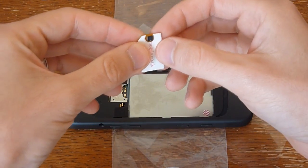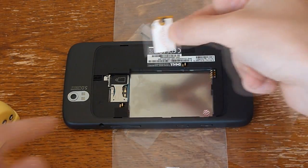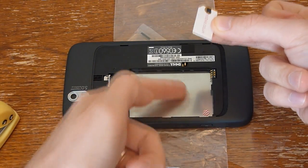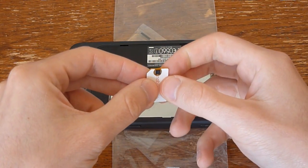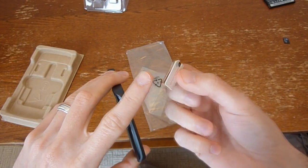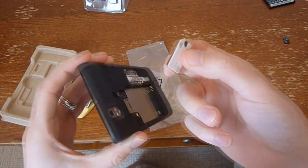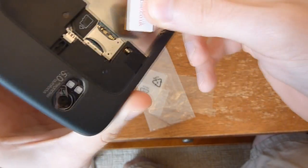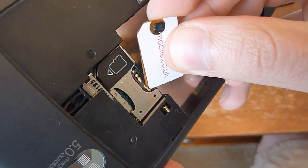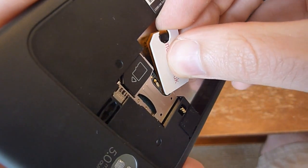The Dell Streak is kind of hard — you can't easily pinch the two cards together while sliding into the SIM slot, because there's no space between where the SIM goes and the casing to fit your finger in there. What I do is take the corner and try to slot it so the Rebel SIM first touches the metal contact, then slide it down in there.